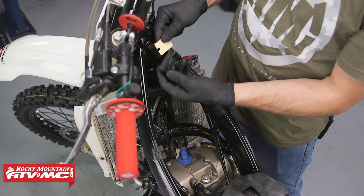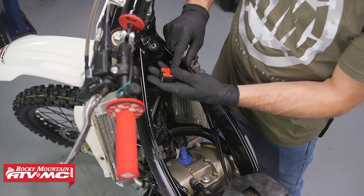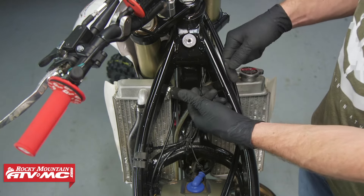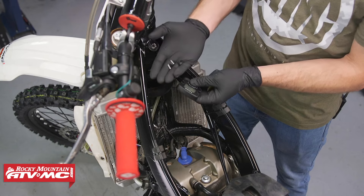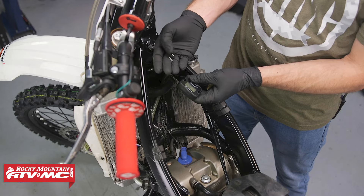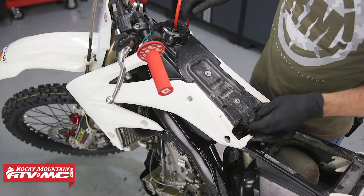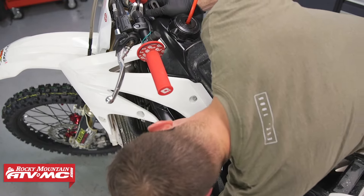You have a few different options. If you're going to use the double-stick tape that comes with it, just put it on the back and stick it to the side of the frame. Clean up that surface with rubbing alcohol, or if it's not painted you could use some contact cleaner. The other option is the two screws that came in the kit — drill two holes a little bit smaller than the screws, put them in place, and there are plastic caps that go on top. Now I'm going to go ahead and reinstall our gas tank and make sure our wire isn't getting pinched anywhere, then we'll mount the bracket on top.